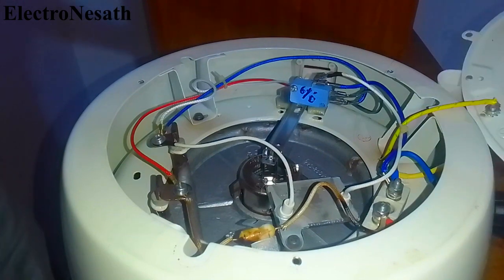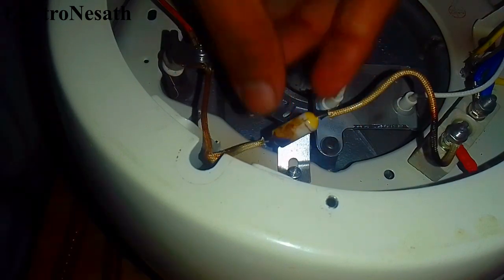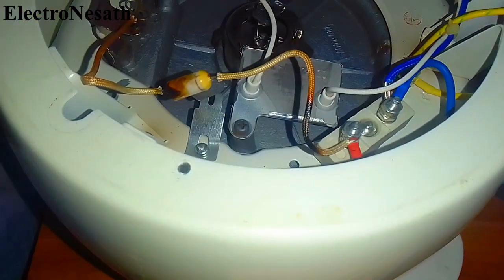As soon as I opened the plate, I saw a burnt fuse. It is called a thermal fuse. If the heat accidentally increases, the fuse will blow, and the rice cooker doesn't work anymore. This is a common fault of rice cookers.